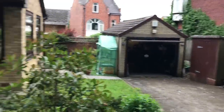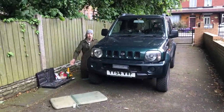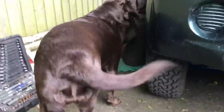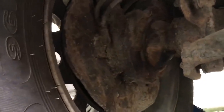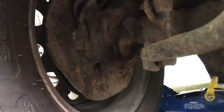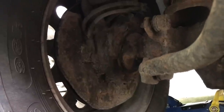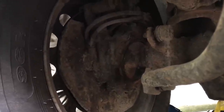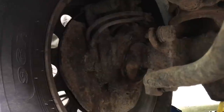Good morning everyone and welcome back to the garage. Today we are working on Kieran's Jimny. We were rooting around under here a few days ago and discovered this horrible mess. You can see around this joint there should be some kind of dust seal which is coming away, and everything's really rusty and nasty. We're going to take this wheel off, remove what we need to get to that, and try and replace it. Kieran also informs me we can replace the kingpin bearings while we're in there, so that's all part of this job.